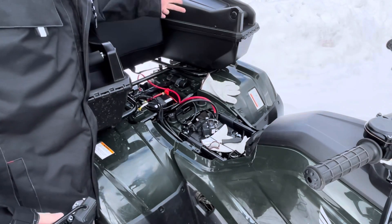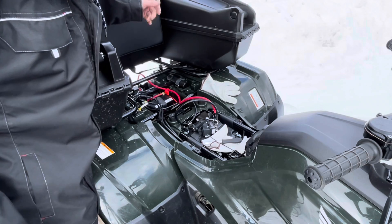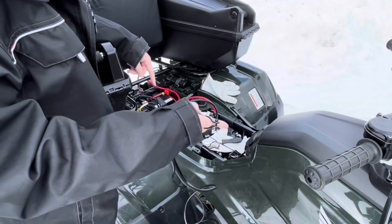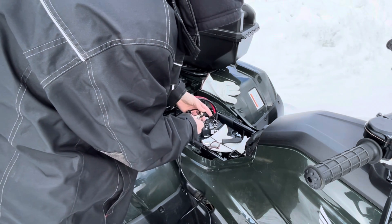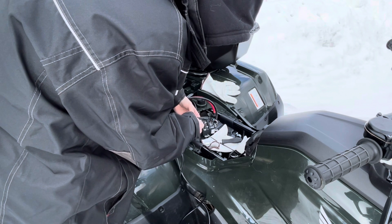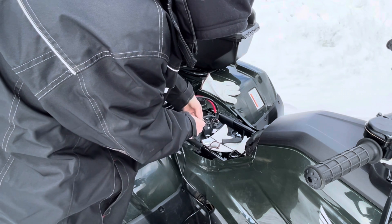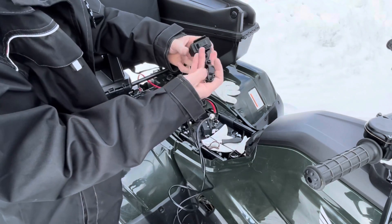I got the positive and negative going straight to the battery. There's a compartment with access so I might have to put the contactor back there. I don't know yet — I'd rather have it high and dry but we'll see. The long wires I think will go to the winch motor. I'm going to test the contactor right now because I'm not too sure how I feel about the rattle it has. This is the controller — pretty handy actually, the way the controller just unplugs and it has a weather seal so you can cap it off with a rubber cap. It has a handlebar mount.